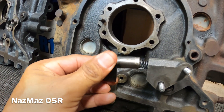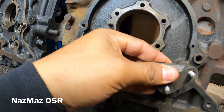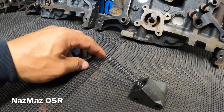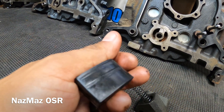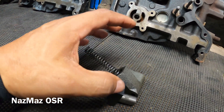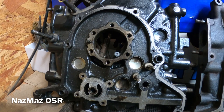After '74 they got rid of it — they figured they really didn't need a tensioner to hold that chain. If you guys are working on one of these old school engines, whether it's a 10A or 12A, you really don't need it. You don't need the extra weight, and these do wear out. The last thing you want is these things breaking or cracking and having to tear the engine down again just because of this.